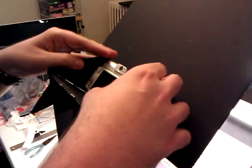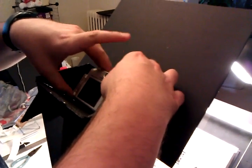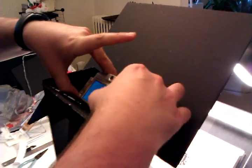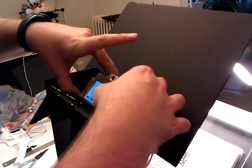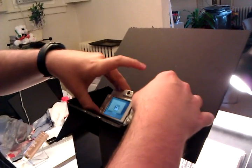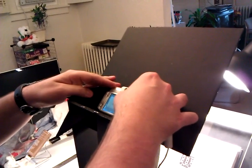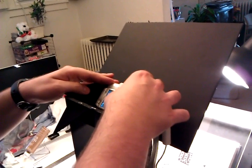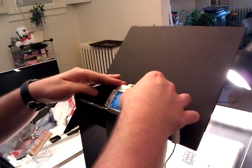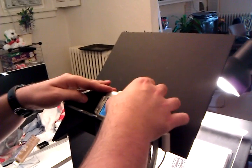In this video I'm going to turn on the camera. I'm using the non-bootable version installation for the CHDK firmware, so I have to turn it on, update the firmware, and then I can use the remote to trigger it. One thing about this camera is that it loses its settings every time you turn it off, so I always have to reset tungsten white balance, turn off the flash, and set the manual focus to about 30 centimeters.